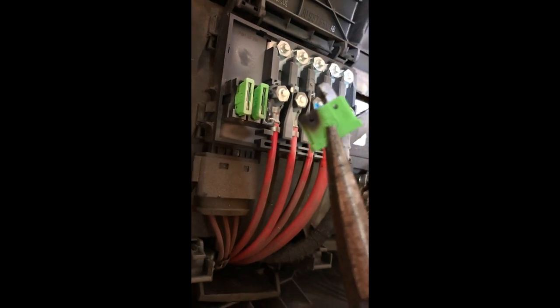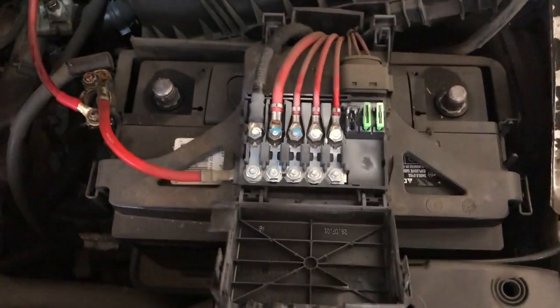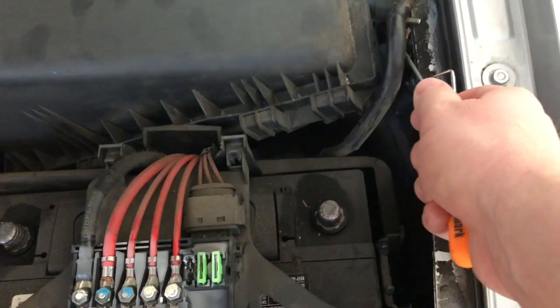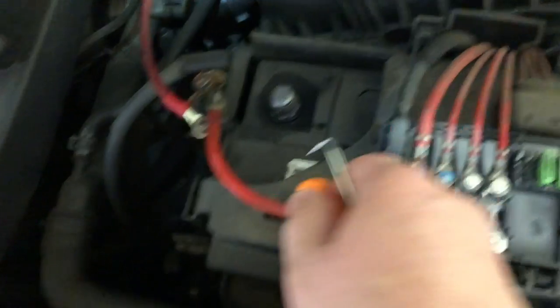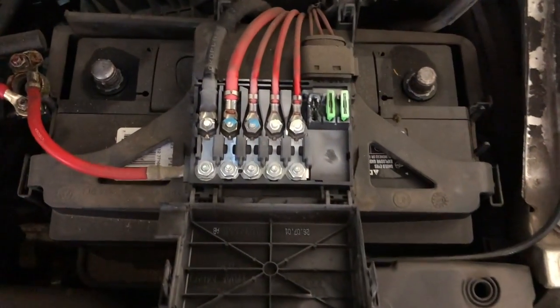As you can see it's gross - this doesn't look like something that Volkswagen would want people to see. Before you start faffing around with this battery stuff, pull off the terminals. I took off the negative with a 10mm, shoved it over here attached to the body, then took this one off and pushed it to the side. Take your multimeter, make sure you don't have any juice going through anything so you don't end up looking like that fuse.